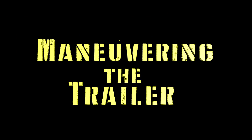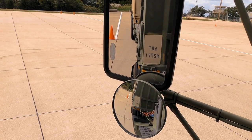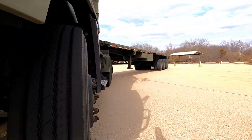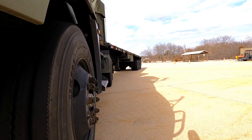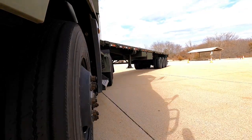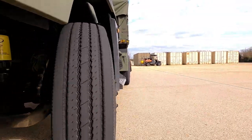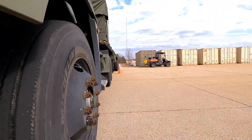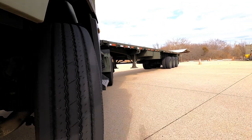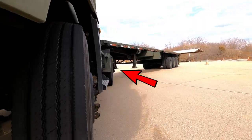The best way to start is to get a good setup. Pull forward until the front axle of the trailer is even with or within a few feet of the cone at the front left side of the alley. Pay close attention not to run that cone over. Stop, turn all the way to the left, and get to the starting point. Put it in reverse and honk the horn. You can see the wheels staying straight as the trailer is pushed off to the vehicle's left side. Once the trailer reaches the point where it is going into the alley dock, begin to straighten out the truck and trailer by turning towards the trailer. One major way to tell the trailer is going into the alley dock is when you lose sight of the cone on the right side. Pay attention to the landing leg on the passenger side — once visible, make sure you don't jackknife the truck.